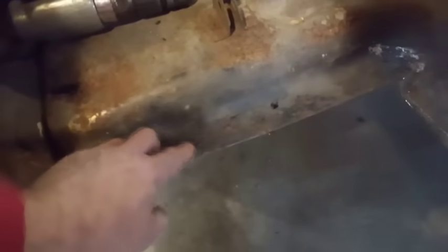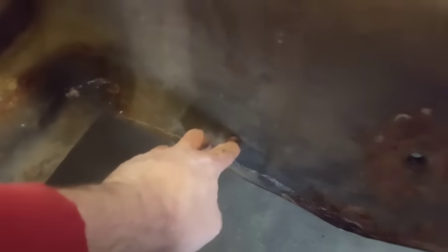I've decided I'm just going to come up to here somewhere. The actual brace for the rear spring hanger is right underneath this here. I cut it right to the edge of it. I got that figured out. I'm probably just going to come up here into the rolled edge along here, keep underneath this seat belt. Just going along here, remove this here, and doing the same thing up here.